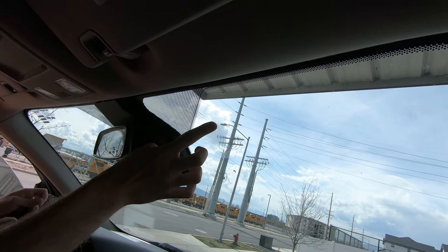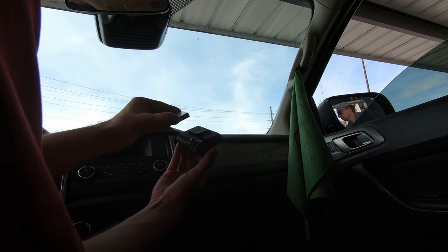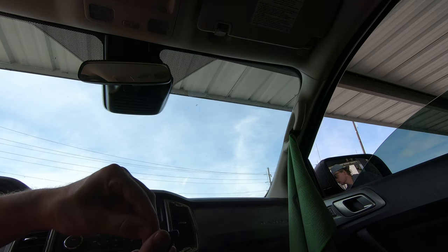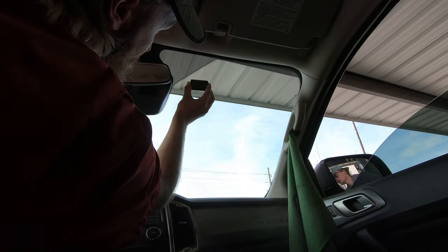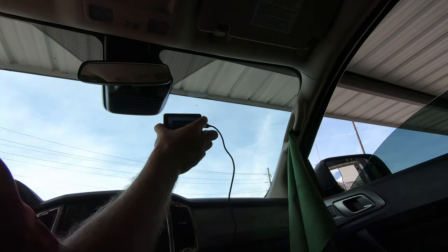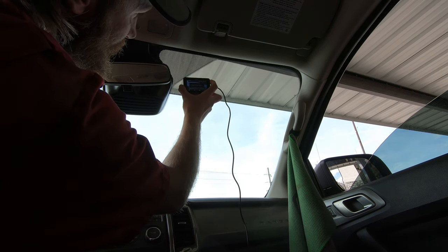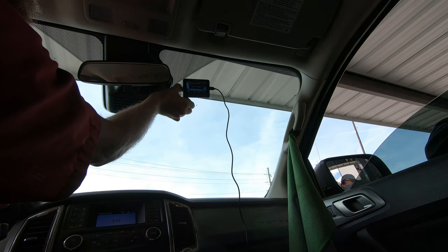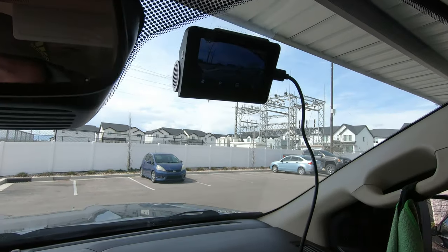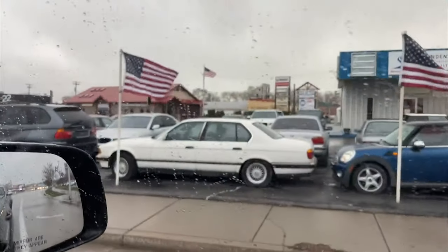This is what the dash cam will actually stick to — if you ever want to remove it, it makes it easy because you're not gluing anything directly to the windshield. Be careful not to install the mount upside down. We've chosen a good spot, and I'm applying the double-sided foam adhesive. I'm powering this on to make sure it's level with the horizon before gluing it on — look how level that is, that's perfect. This has a really wide angle lens — the white car over there is directly beside us and you can see it clearly.